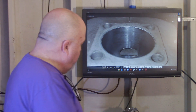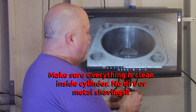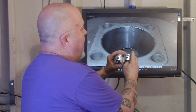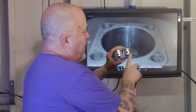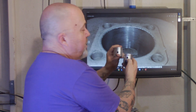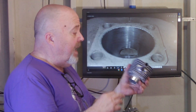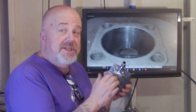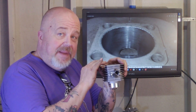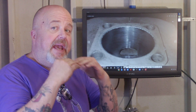After putting everything back together, make sure your piston doesn't come up higher than the deck — if it does, it'll hit the cylinder head. There's an A piston and a B piston; the difference is the location of the wrist pin. If the engine calls for a B piston and they mistakenly put an A piston in, it puts the piston up too high — I've seen that happen. If your piston is a little too high, add an extra base gasket underneath the cylinder jug to raise it and keep the piston from hitting the cylinder head.